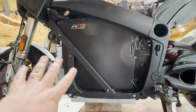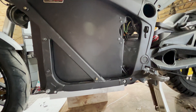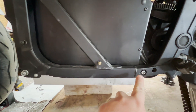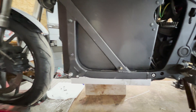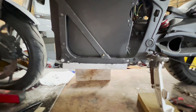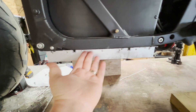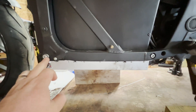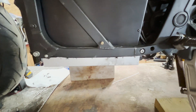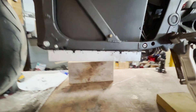When you get done with that, take off the rest of your bodywork — your side panels, your tank, your seat. You take all that off so you can get access to your battery. The only thing holding this battery in place is this bolt, this bolt, and matching bolts on the other side — four bolts, that's the only thing holding the battery in place. The first thing you need to do is support your battery. I used my trusty milk crate. I jacked the bike up a little bit and slid it underneath, so basically the weight of the bike was sitting on the milk crate. You want to make sure your battery pack is well-supported underneath. Once it's well supported, you remove these four screws — these two and the two on the other side. Now your battery pack is free of the rest of the bike.